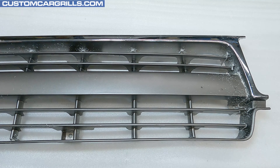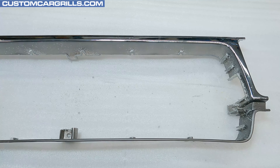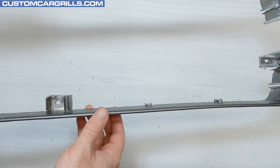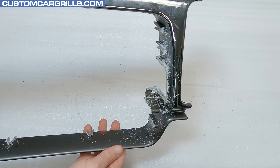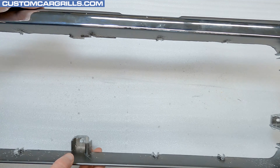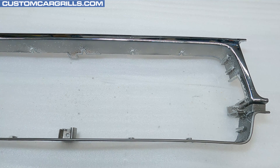The center part should be freed up now and can be lifted out and thrown away. Here's how my grille frame looks now. This is a pretty rough cut, but it's got it where it counts. The mounting tabs are still in place, but there's a few things to tackle in the upcoming steps. The tabs need to be refined and the frame needs to be sanded, as well as the back edge needing to be trimmed down.